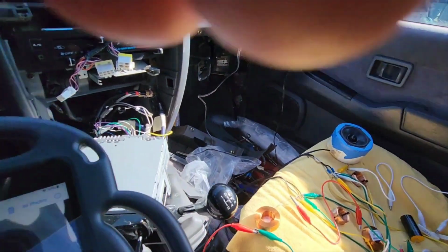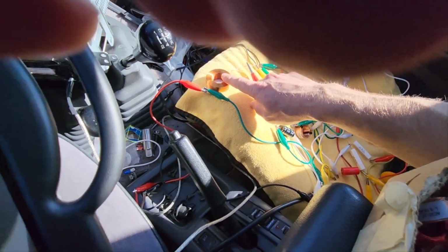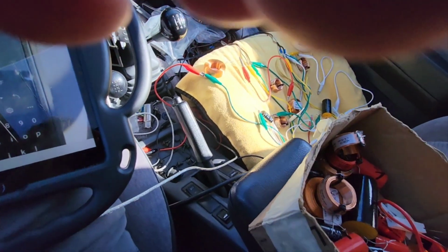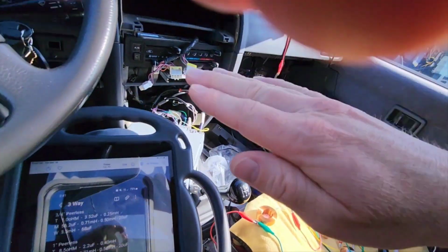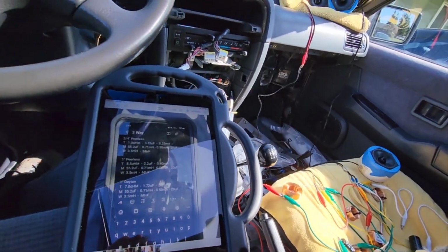And for the 5 1/4 in the back, I'm just going to use the same 3.5 mH and then a 68 uF just for the back. And I'm going to probably turn it down a little bit more than the front, just to have a little bit of fill. So it shouldn't affect all the work I've done with the crossovers. You get a nice flat frequency response that sounds good. So just fill in a little sound and won't change it too much. But yeah.